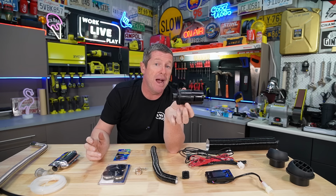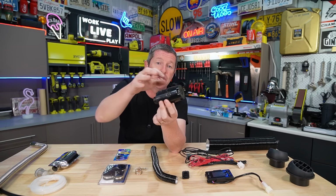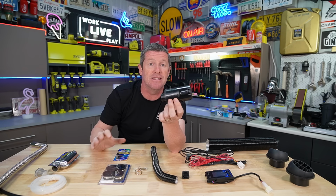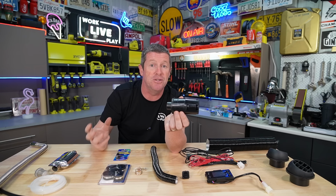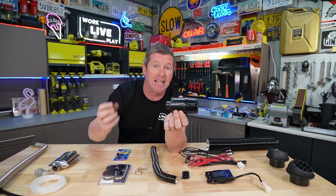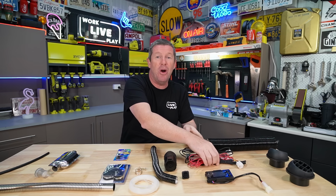I think it's a really good practice to have it somewhere where it's easily seen so you can inspect it and make sure that we're getting enough air into the system so it's not sooting up the heater itself and causing those issues you get with the diesel injectors gunking up because there's not the right fuel mixture going through. So if we get the wiring loom out now,